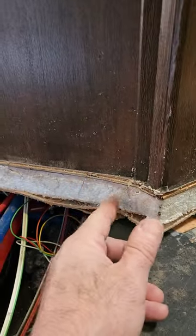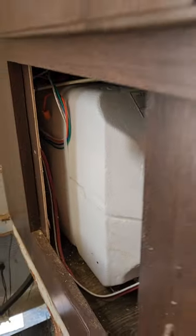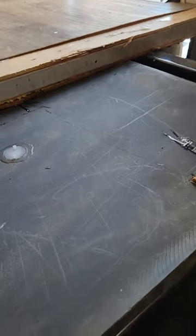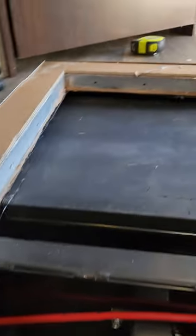So the first thing you got to do is get the old bad stuff out of there. This is the old floor — it's just styrofoam, and any kind of water intrusion whatsoever is going to ruin it. There's the water heater. What I found is you have to cut back to where you get something you can work with. There's aluminum inside this floor, and I removed everything and kept searching until I found a spot where I could get to the aluminum and make a frame.